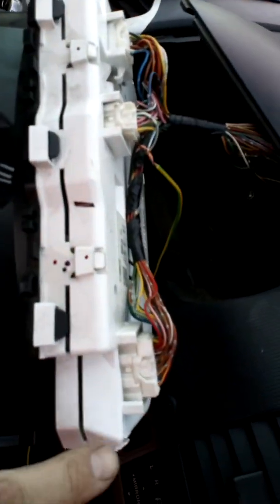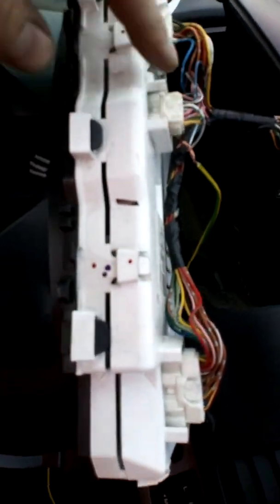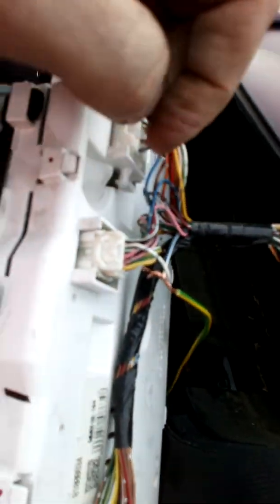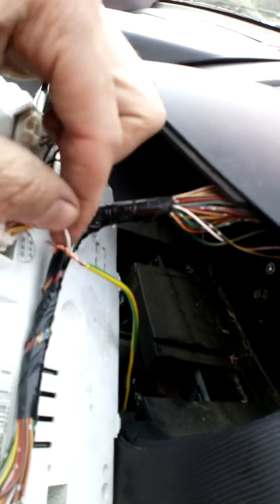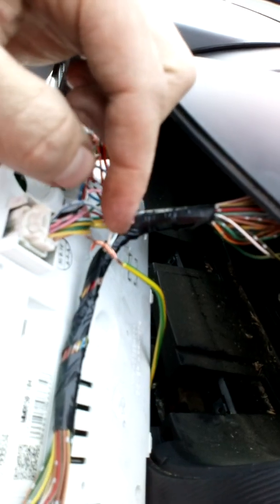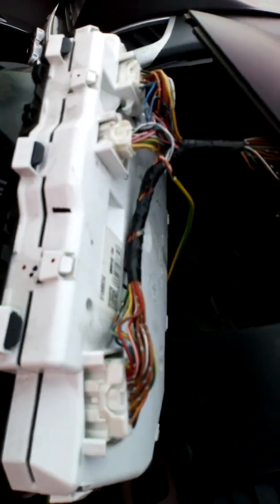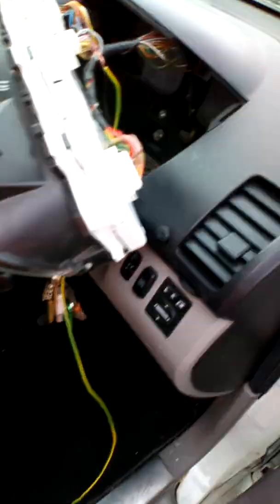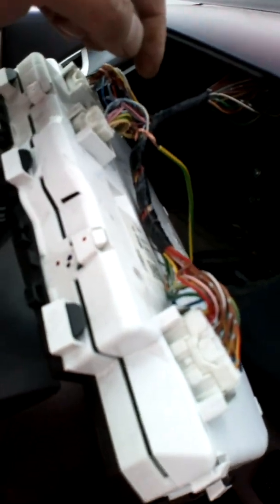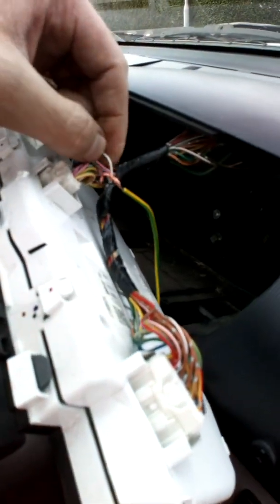You've got three plugs — it's your centre plug. Look for the white wire with a blue tracer, which is this one. Do the same again: pull the casing back and just twist the wire onto it, so you're basically putting a new wire in. I trapped it in the door and went for a drive with the clocks loose. It's obviously a break in the wire because it's working with this wire in place.